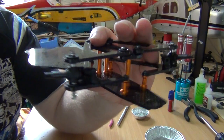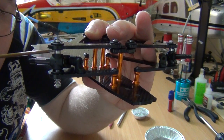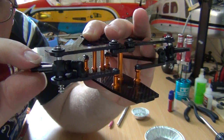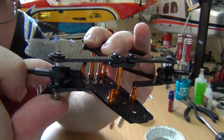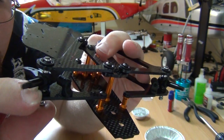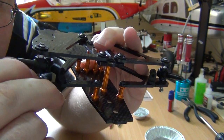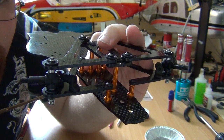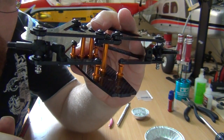If we look here, you can see there's a whole heap of shims — you can move them up and down. What that'll do is adjust the ride height of the steering arm and shaft. You can see the shaft will actually move up and down — there's the suspension movement. You can use different oils to change the dampening characteristics.